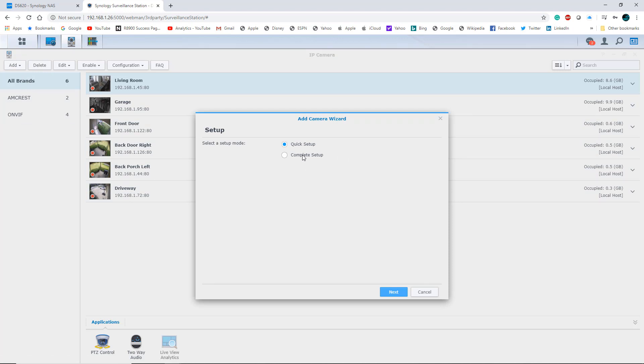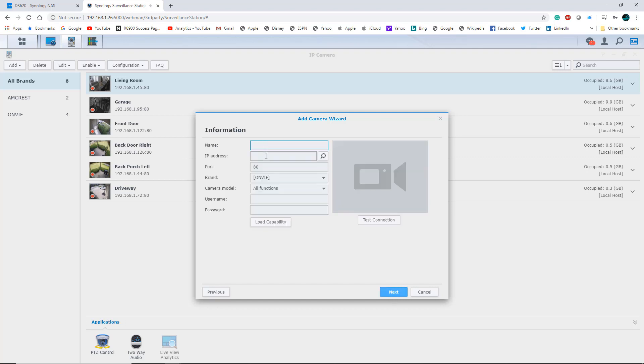To add your cameras: launch the IP Camera application, click Add Camera, and I usually do a Quick Setup since I can go back and edit settings later. From here you can name your device, put in an IP address, and if you know the brand and model you can select it. I do recommend looking at the compatibility list to see what's supported out of the box — here's a full list of supported cameras for Surveillance Station. They have brand names listed, but you can also select User Defined or ONVIF-compatible cameras — ONVIF is basically a global standardization for streaming cameras.